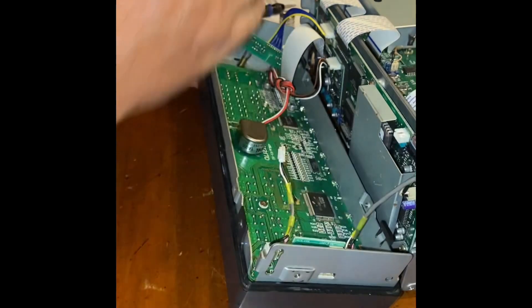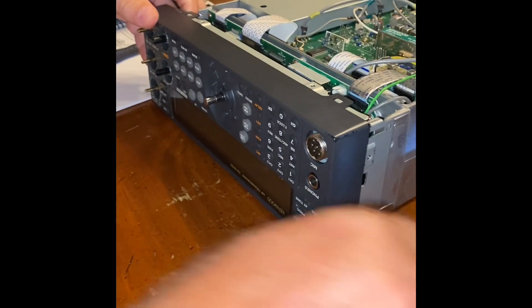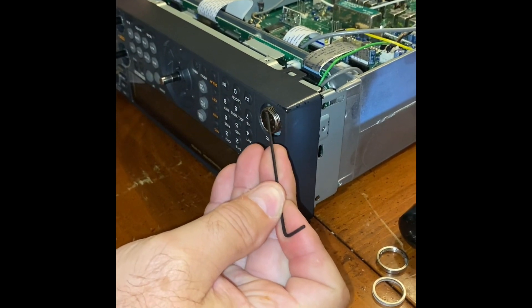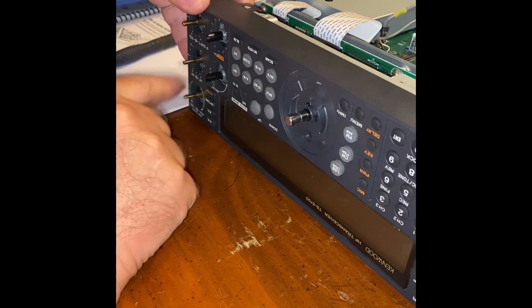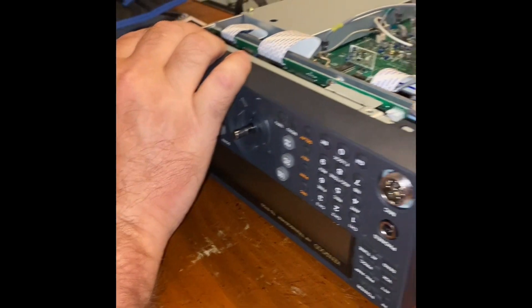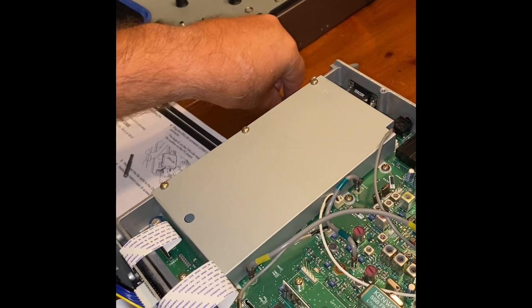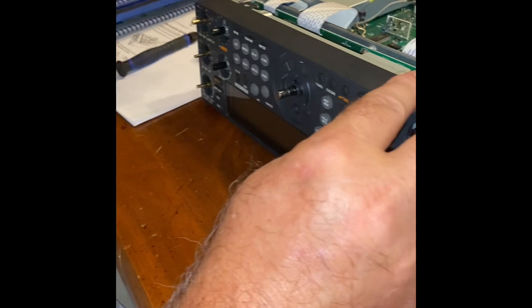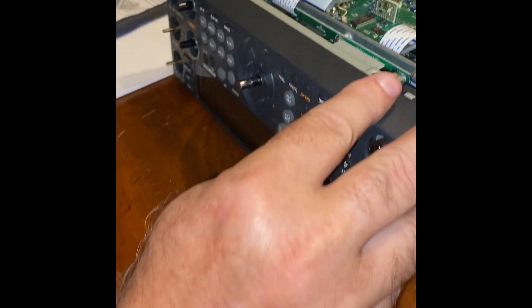To get to this, you remove the two screws on each side. You're also going to have to remove the ring — the inner ring and outer ring. You can just reach in with something and tap it gently to remove the ring for the mic port. Remove both inner and outer rings for all your knobs. Here are my knobs laid out in configuration to reinstall, along with the little nuts. There is also a locking pin that is removed by just turning it off.